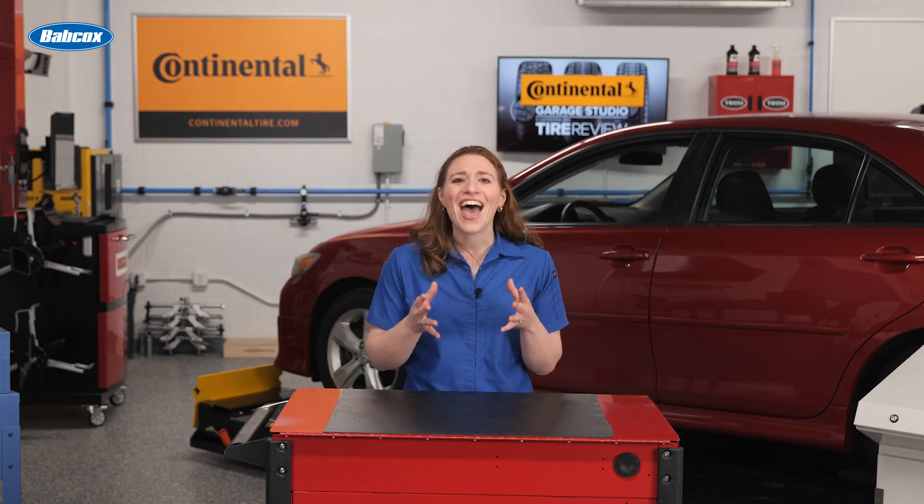The other day we had a 2016 Kia Soul in our garage for a video shoot, and suddenly the right rear wheel locked up solid. Upon further investigation, we saw that the brake pad's friction material was worn down to four millimeters and was getting close to the wear sensors on both sides. The inboard pad on the right side was missing half of the friction material. Corrosion was the culprit. So let's talk about how to spot brake pad system failures before they happen.